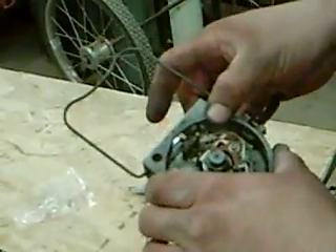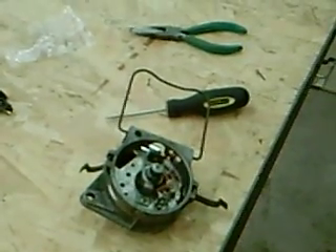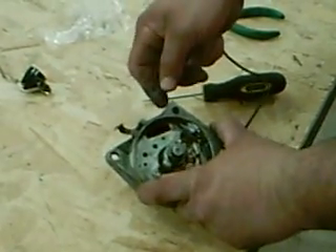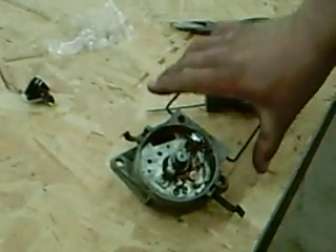All that will be left to do is to put some grease here on the very edges of the cams — a light grease would be perfect. And the distributor has got its new set of points in it. This is the beginning of a series of how-to videos that we'll be making. That is in essence what it takes to put the points in a front-mounted distributor for a flathead Ford tractor engine — the 9N, 2N, and 8N. Thank you for watching our video, and we look forward to making more and having you watch more of them.